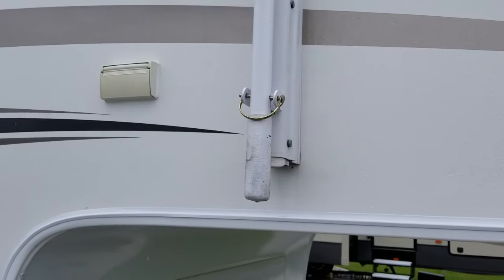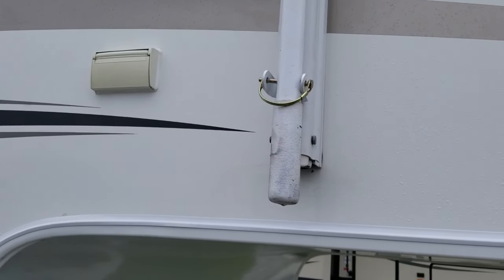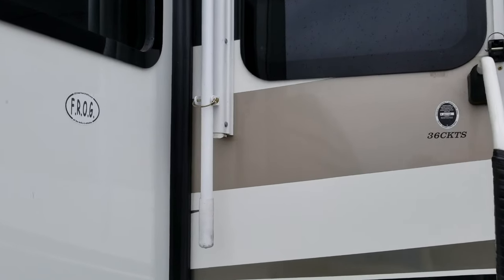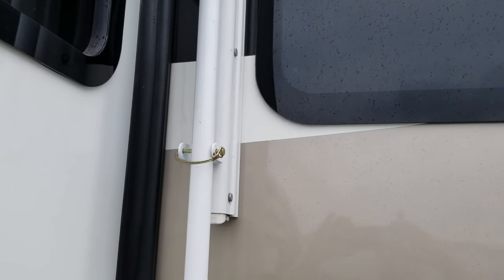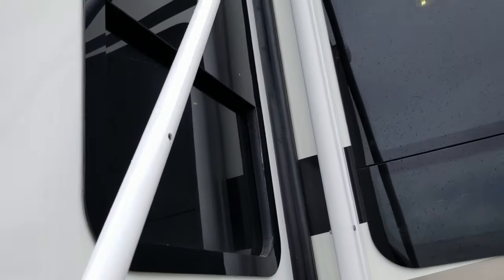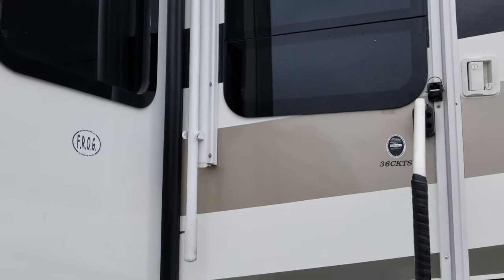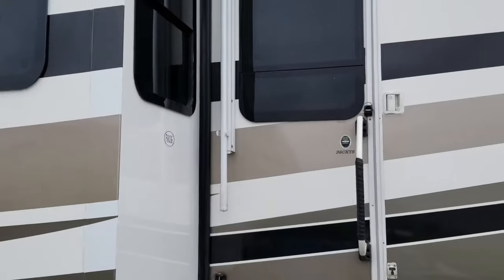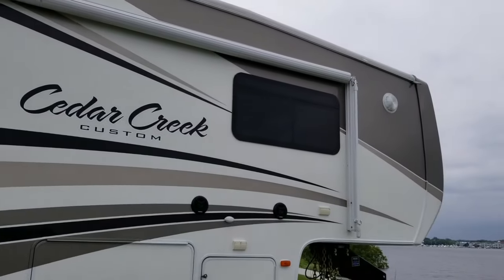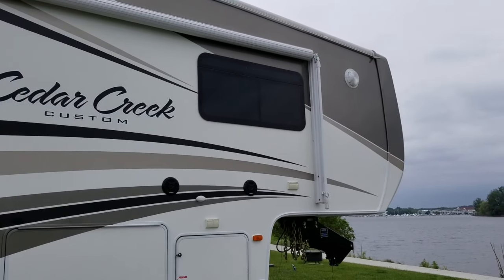As part of completing the install, I went ahead and got some Krylon paint and painted the pole white so that it actually matches the RV. This particular one we also had to cut down a little bit because it was hanging down too far and would hit the side of the bed when hooked up. This other one down here is going to be a little bit longer — about six inches longer because we didn't have to cut it off. You can see it hanging down there; it also has the hole drilled through it with the D-clip holding it in place, so when we deploy it it's just a matter of pulling it out, rolling the awning out, and adjusting it to whatever length we need, putting it in, and tying it down with the ground tie-down. We don't have it set up in this particular campground because this campground does not allow us to put any stakes into the ground due to the irrigation system, but you can see both poles — it's just a matter of rolling the awning out and unclipping them.